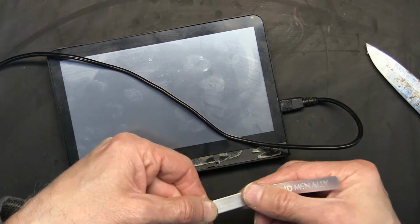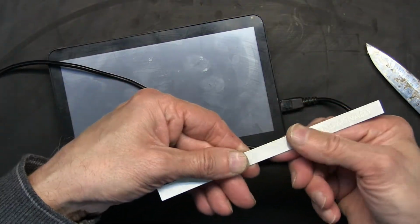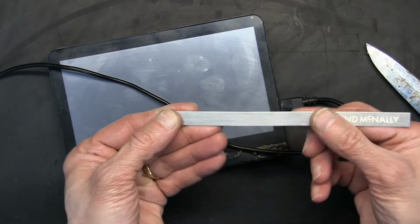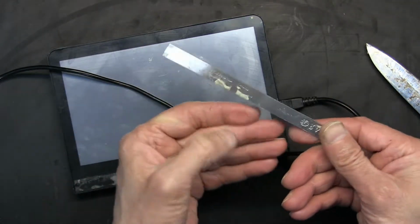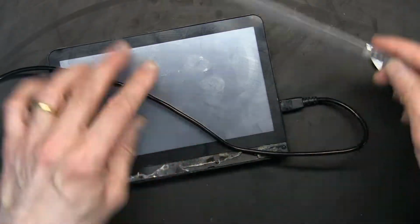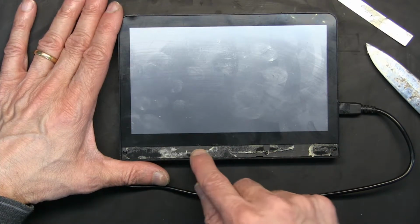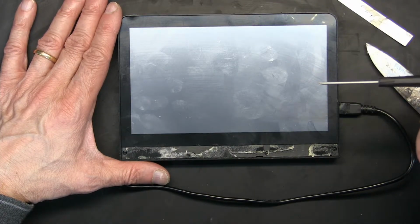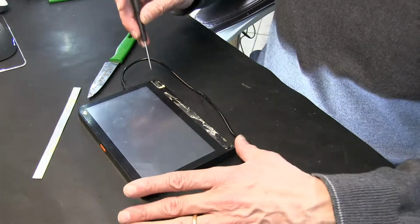So you have to straighten this, because you will be using the same plate. Now the adhesive that they use, it's not reusable, so you have to wipe this clean and put a double-sided tape to put it back in place. All right, 4 screws, 1 2 3 4. You have to remove 4 screws. It's a standard Phillips screwdriver, so you're gonna use a standard Phillips screwdriver.